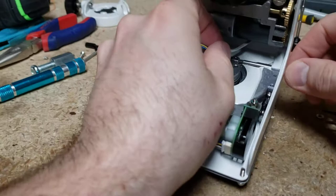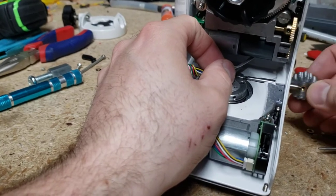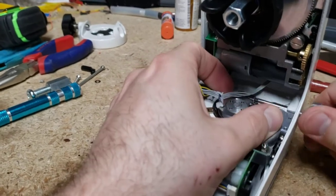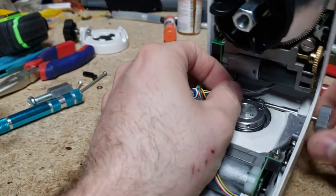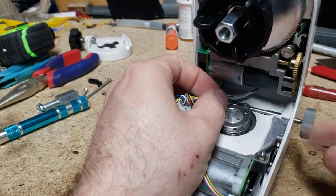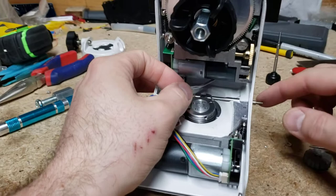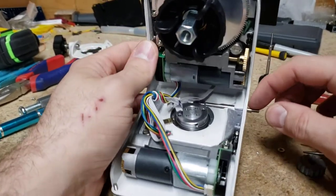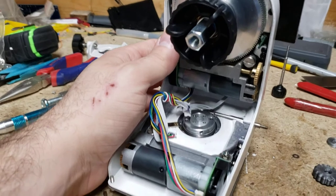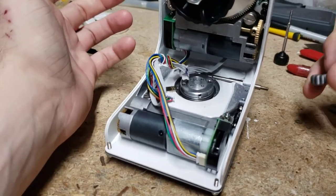This part needs a little wiggling. You can actually just put on a bolt and nut and really kind of wiggle it as you do it. Just make sure it's docked up against this piece here. Then you would just mark it and cut it, which I've already done. These come in like foot-long sections, both of these. Just cut it as flat as you can. Mine's a little discolored from being cut by an angle grinder that wasn't set up for cutting at the time — a lot of friction, a lot of heat — probably messed with the metallurgy a little bit, but whatever.